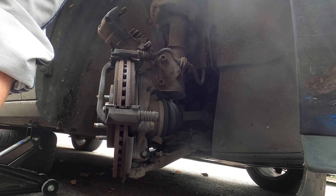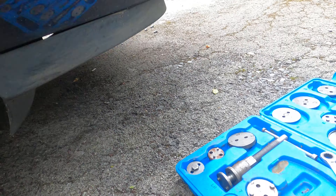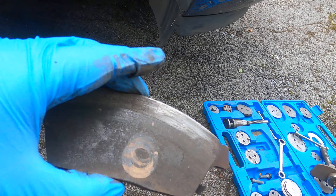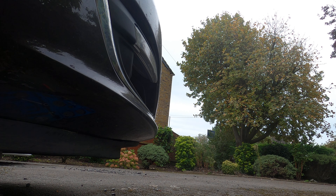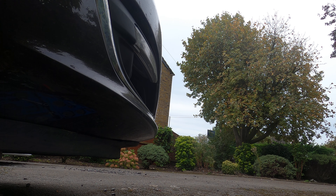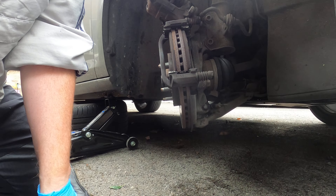You're going to need something to compress this cylinder - the piston, sorry. You can either have a brake compression kit like this one I bought off Amazon, or a G-clamp, but something you need to apply a lot of pressure with. These kits come with loads of discs and stuff, but really all you need - I've already done one side of the car - is just take your old brake pad, plop it in and then set the compressor up. Just get it sitting on there and then turn it by hand. This plate goes here, this turns down, and then just turn it in until it's closed up.